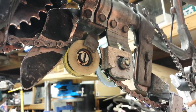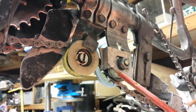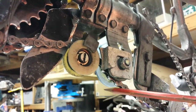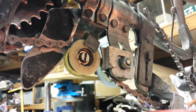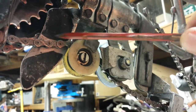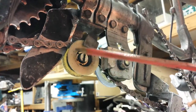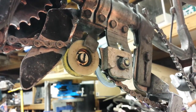The first thing that would be obvious is dual rollers or dual idler wheels. With the resonance, you would end up having slackness in the chain even though the derailleur is supposed to be keeping the chain in tension. When traveling over bumps or rocky surfaces, the chain slap would be so bad that it would cause a complete loose spot and then chainsuck. Initially I started off with one roller and that had some degree of result, but it still didn't solve the problem.